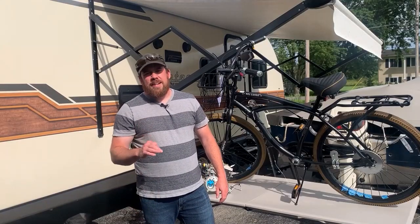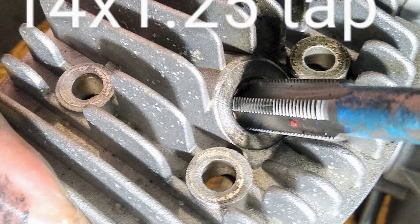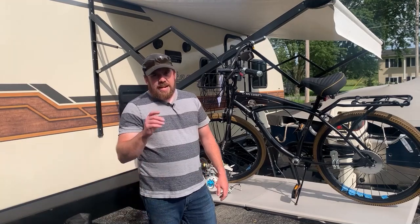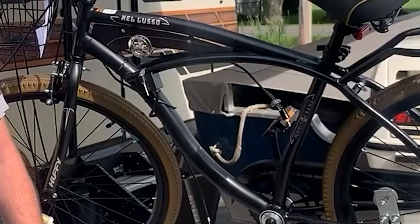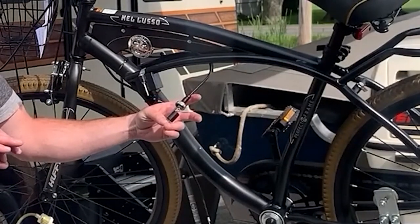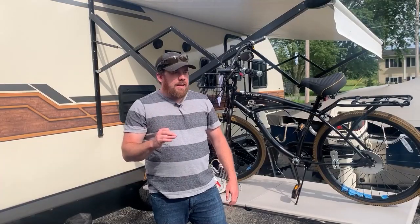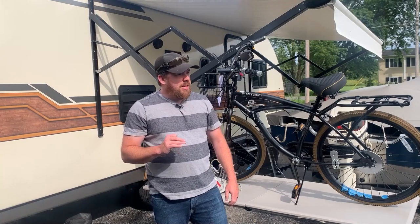He also donated an NGK spark plug. It's a touch cooler than the spark plug that's in there. We're gonna lean out this machine and make it mean. And the way we're gonna do that is we're gonna adjust this needle right here and lower it a touch by adjusting the clip. I found out that I didn't need choke at all to start this up, so I just know fuel is just getting dumped right in.